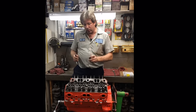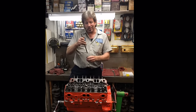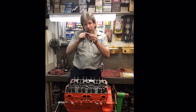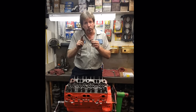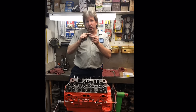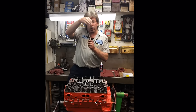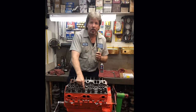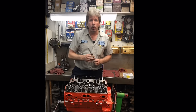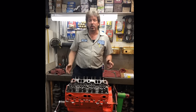When you've pumped up your lifters and put them down inside the engine, and then you go to adjust a rocker arm, instead of getting the push rod pushing down the little spring in the plunger inside the lifter, which is what you're shooting for, around 30, 35 thousandths of depression, you wind up with the lifter hard, so the rocker arm will push down on the valve instead. So once you've adjusted your rocker arm, your valve is hanging open a little bit. When you start it up, that rocker arm's hanging open a little bit, and this thing doesn't want to start.